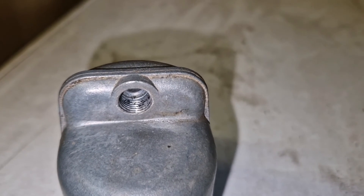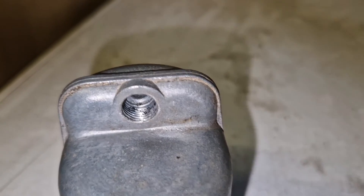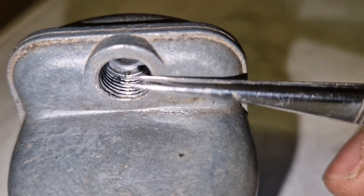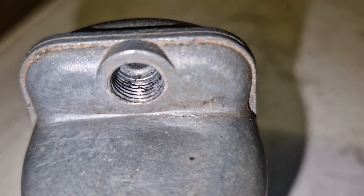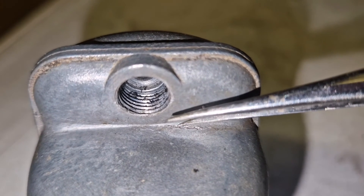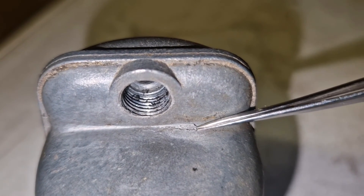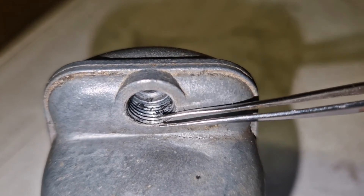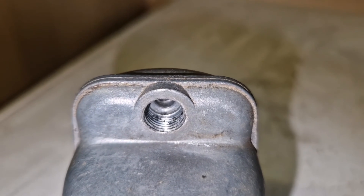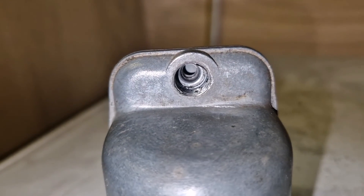As it turns out, it wasn't the end of the pipe that was leaking, even though I changed this seal inside two or three times to try and sort it out. If you've got a good eye, you will see the float bowl is actually cracked here. The leak was coming out of here, which is directly above the hole, so it was misleading me into thinking it was leaking from inside the seal area.